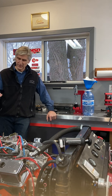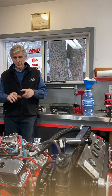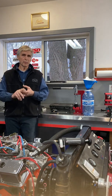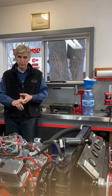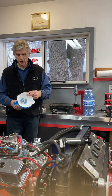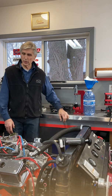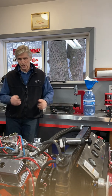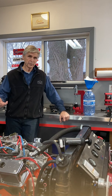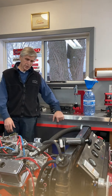The next thing I still need to do is drain the oil. After break-in on the test stand we always drain the oil before going to the dyno, then put break-in oil back in, since the rings still aren't broken in. We change the oil and filter, and when I drain it I'll run it through a very fine paint filter — if there's any debris or shavings in the oil, we'll find it. Then I'll cut the oil filter apart, spread all the pleats out, inspect with a bright light, and make sure there's nothing in there. Anything going wrong will show up in the oil or filter.